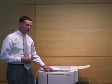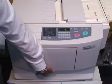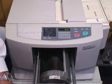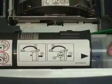The next thing we'd like to talk about is how to change the consumable supplies. There are two supplies within the machine. The first is the ink. To change the ink, simply press cylinder release on the panel. The machine will beep and you can remove the cylinder. Then flip up the green lever and take the ink tube out.